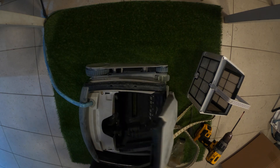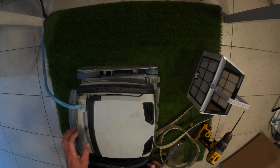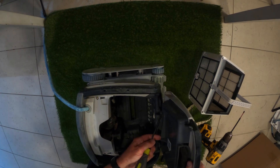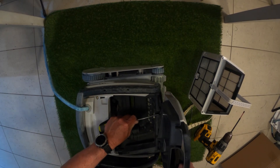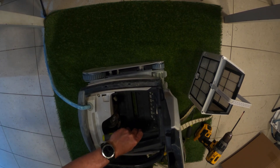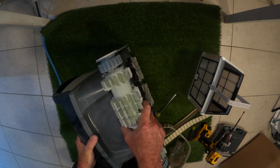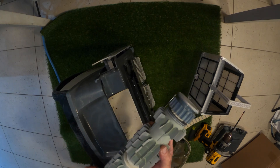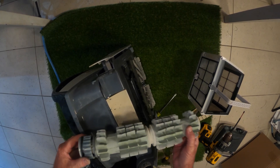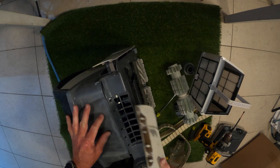It can be a good idea to take off the top lid, as you often get debris caught down here. You should be able to clear the debris — you can use a screwdriver or a hose to flush it back out. Lever it carefully and the lid will come off, giving much better access. You can pull off this brush and that comes apart. All of this brush is replaceable quite simply. There's even a gum nut stuck in here — this rapid drain flap just pulls off, so that can be replaced too.